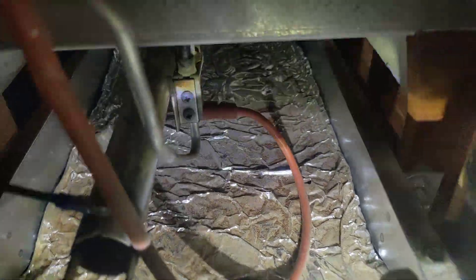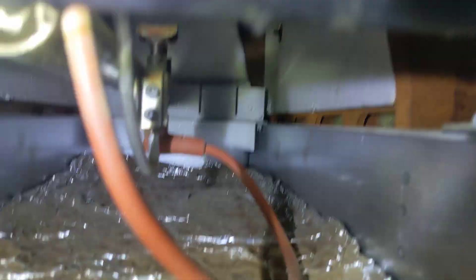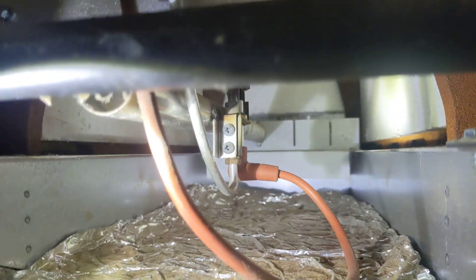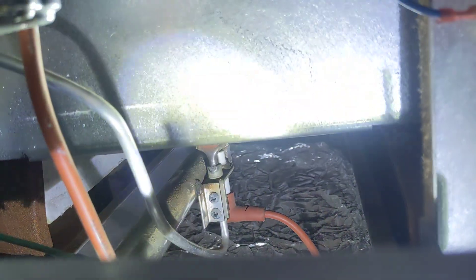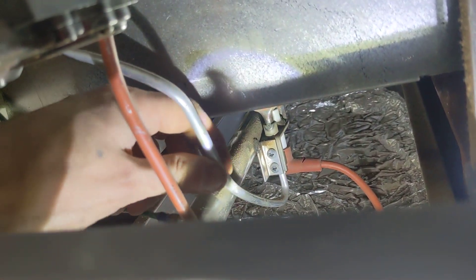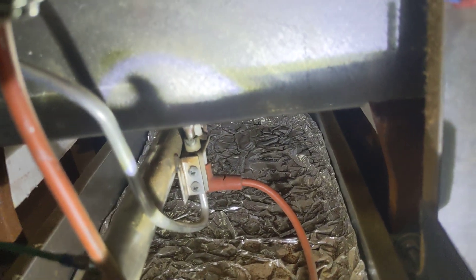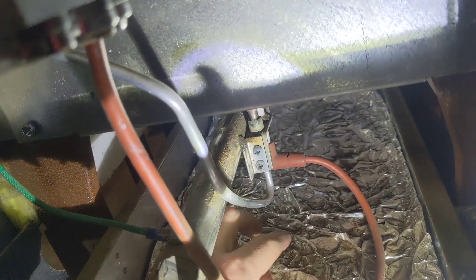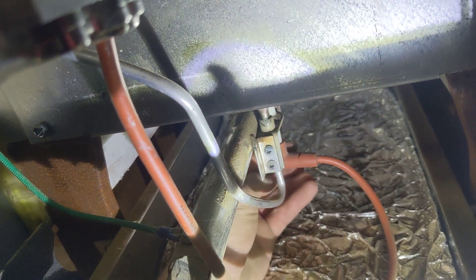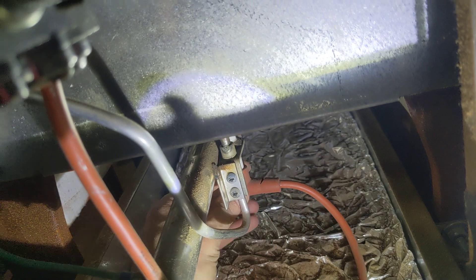Basically all I did was pull the rest of the burner tubes out, got up in here as best I could with the steel wool, and tried to clean that flame rod. I'm too lazy to pull the whole pilot assembly out right now because this tube is all connected — it goes into the gas valve. I'd have to pull the compression fitting off the gas valve and unscrew these two screws here. It doesn't look like the components for the spark plug wire allow you to pull it out independently.